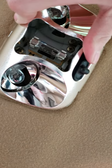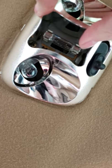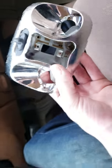Be very careful when you pull these apart not to let your screwdriver touch either side of the light bulb contacts or any other metal part inside the housing. The housing is plastic so you don't have to worry about that, but watch out for these terminals. If you don't feel safe doing it, just unhook the battery on the truck — it'll make it a lot easier.